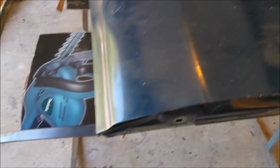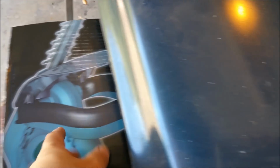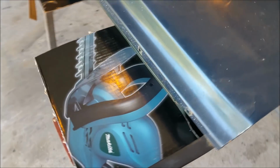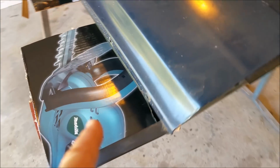I hope you enjoy. When we're coming to strip paint on the doors, it's not that hard. A couple of things will depend actually. This is all full of blisters, can you see that? Now it's not too big of a deal, because we can have it on these trestles. There's a bit of old cardboard there to stop the stripper sitting in the timber on the trestles. Now what I'll do, once these are all stripped and they're all hunky-dory, is staple some carpet there so I can flip the door around and it won't get all scratched up.